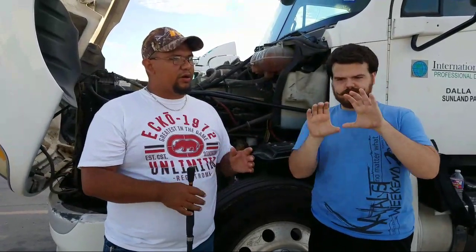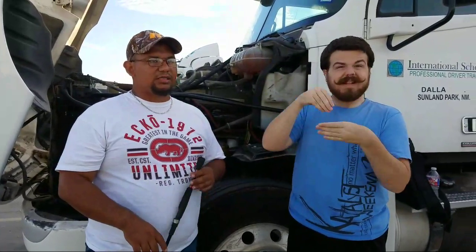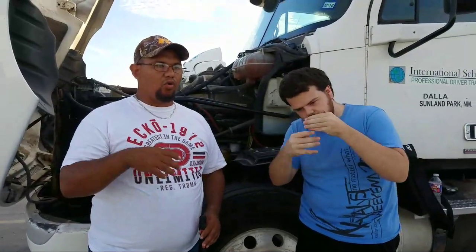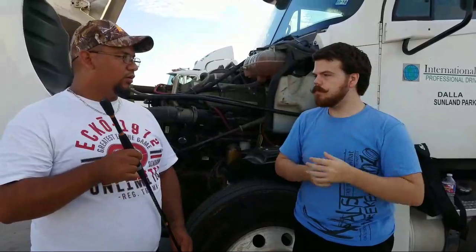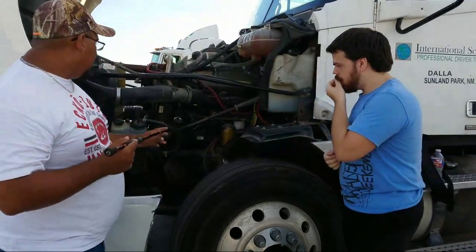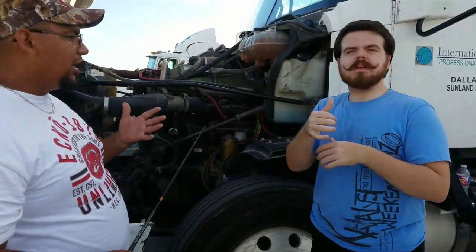Like I said, if it's a metal component that sticks onto the engine compartment, then it must be checked the exact same way: properly mounted, not cracked, not bent, not broken. If it has fluid inside, make sure you check for leaks. Any kind of fluid, air or liquid. Okay, so from there, guys, there are a few other things that I'm not naming.